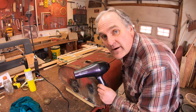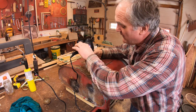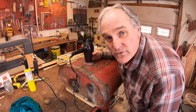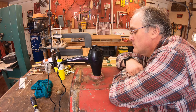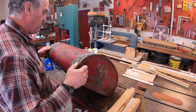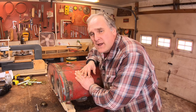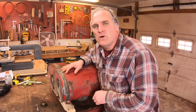Next step is to dry the tank out with a hairdryer and then swish some motor oil around in there to keep it from flash rust. I'm blowing air in the big hole and it's coming out the little drain hole, so it doesn't dry very well, but it'll be all right. This tank should be ready to go. I coated it with oil, took the bottom drain plug out, and I'm letting the excess oil drain out — I'll leave it this way until we install it on the tractor in the next video. We'll start the tractor up and drive it around — a hundred-year-old tractor alive again. Thanks for joining me. I'll see you next time, and have a great day.